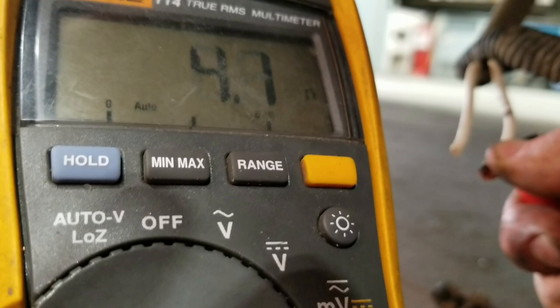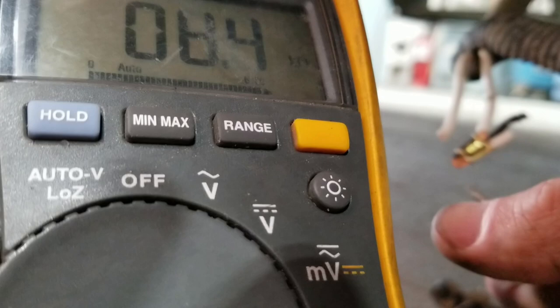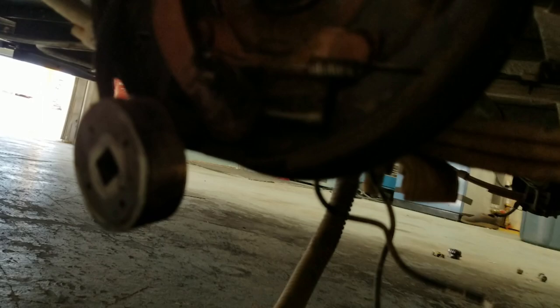Paralleled, that's going to give us half that — 2.1 ohms, much higher. So what is going on? In the forward wiring, we should have infinite resistance. There we go — we're not shorted. What does that mean? It means one of these connections is janky and shorting to ground.